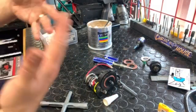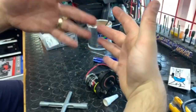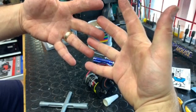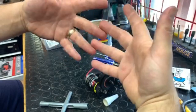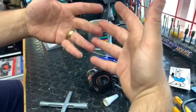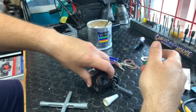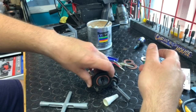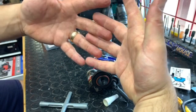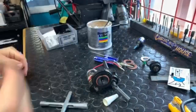So, I always do the finger trick for guys, okay? So, picture your gears kind of like your two hands here, okay? So, we go too loose, chip the teeth off. We don't want that. We don't want these two gears to be so tight they chip the friggin' teeth off. Too tight, rolling resistance. This has rolling resistance. It's going to, and it's going to be only slightly. So we want to have the mama bear. We want to have just a little bit. And then you give yourself a nice big handshake when you're done, when you do a good job. Look what I did there.